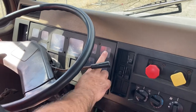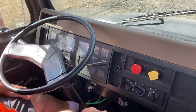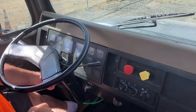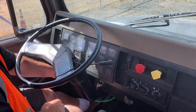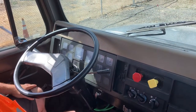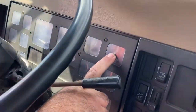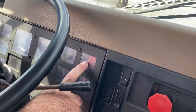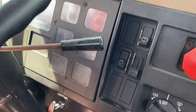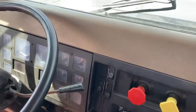We're well below there. So now I'm going to do a safety start so that I can build my pressure up and check that my air governor has cut in. I'm watching my air gauge here and it is climbing. I can see that it's working properly and we're building pressure. The air governor has cut in below 90.